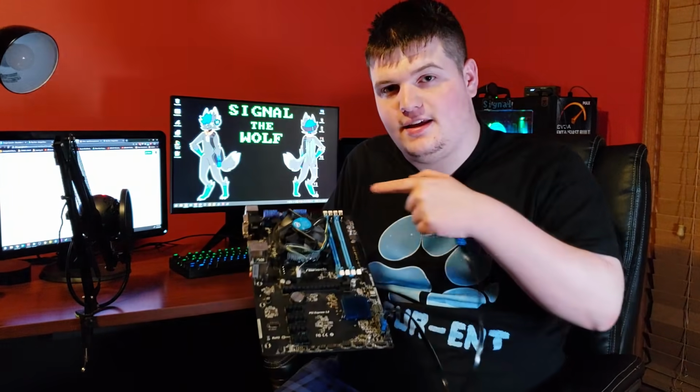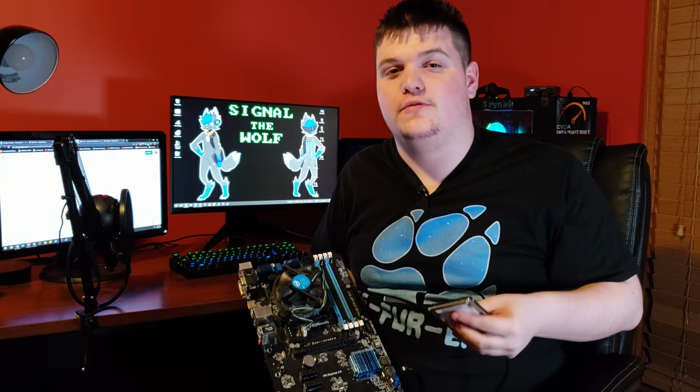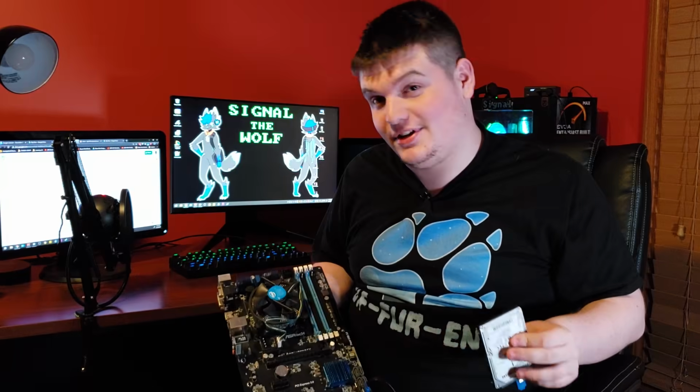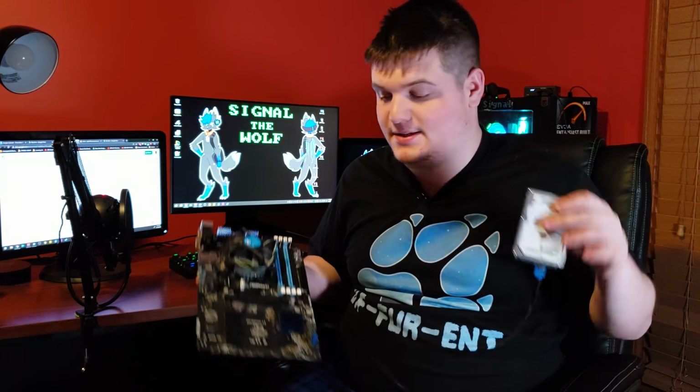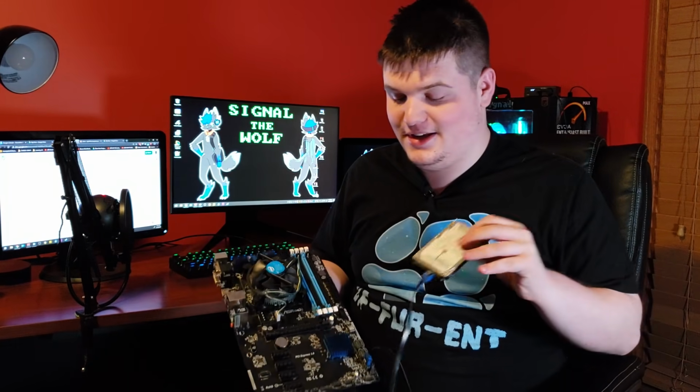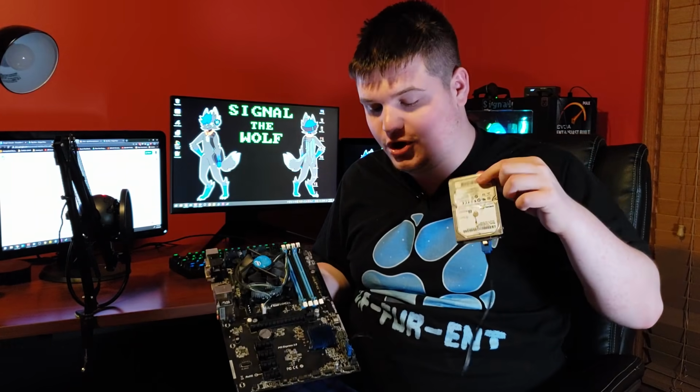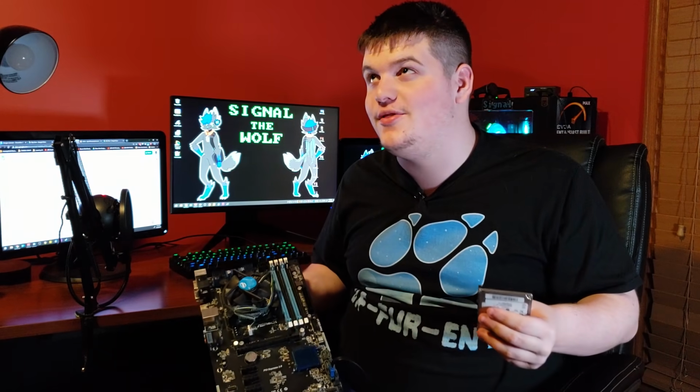Next, you're going to need at least a 64-bit CPU for the newer versions of FreeNAS. You can run 32-bit computers on older versions of FreeNAS. I believe the latest version is 9 point something or other, but we're on 11 now, so use a 64-bit machine. Most old computers at this point are also 64-bit, so you should be fine. This isn't the computer I'm going to be using directly, but it's just to demonstrate. You're also going to need hard drives connected directly to the motherboard. RAID cards are not supported. Well, they're supported to some extent, but really not recommended.